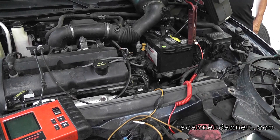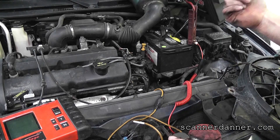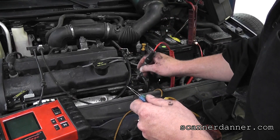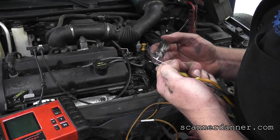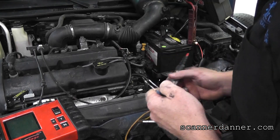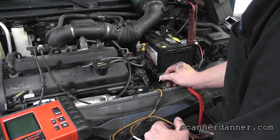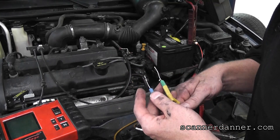I'm not sure why I can't do a bypass test on Fords. I have my friend Jim here looking at the scan tool to see if the RPM changes. We're giving it cam by cranking it, and I'm giving it the crank by moving the signal back and forth. No RPM signal. I'm really disappointed that I cannot induce a voltage on a Ford. Just the way the circuit is monitored with the floating ground, I just can't simulate that signal.